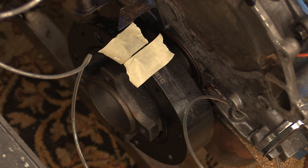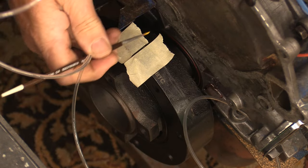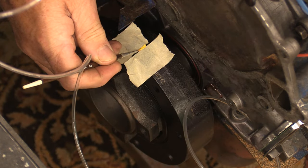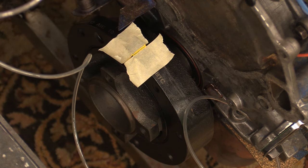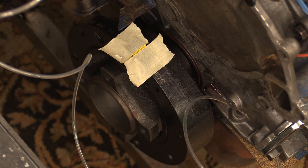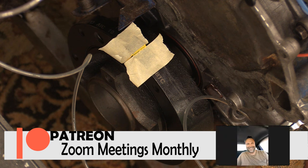I'm going to mark that in yellow, and then I'm going to mark zero on here again as well in a second with a silver paint pen. This will give me a sure timing mark for when we're going in and setting everything up after we get everything started. I want to make sure I can basically get in here and do what I need to do with our initial startup on the engine without having to try to find 16 degrees.